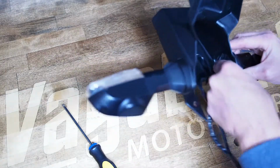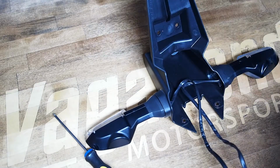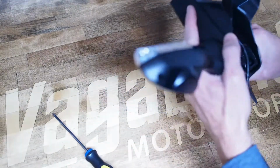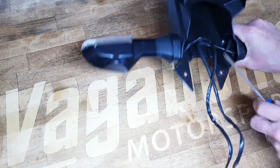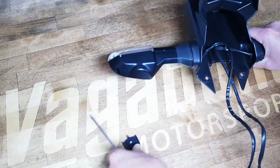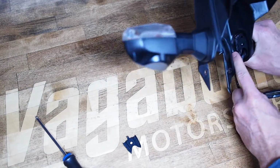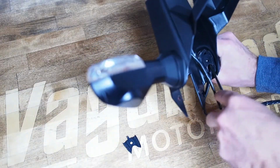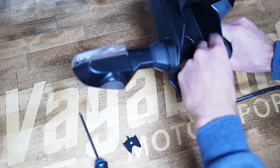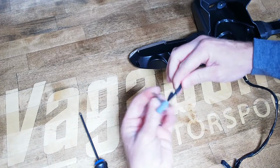Now once you've got those plates off, the remaining steps are to lift that plate up. You sometimes have to pry at it a little bit with a screwdriver. We'll do one side first. Once the plate's up, there's going to be an interior threaded plate, like a nut plate. Same thing, grab your Phillips screwdriver and pry it out. Pull that little nut plate out. We are going to reuse all this hardware.